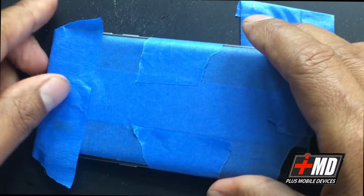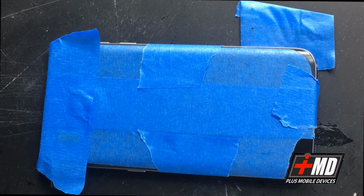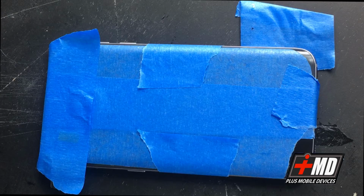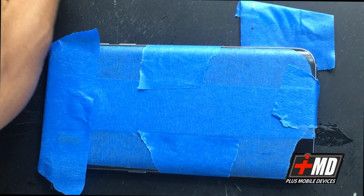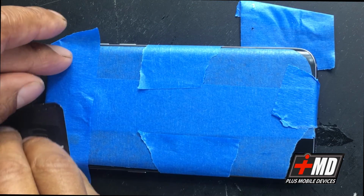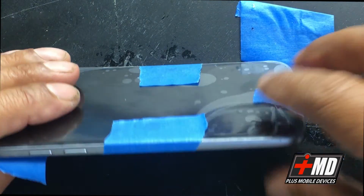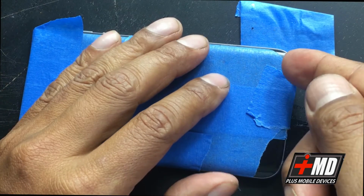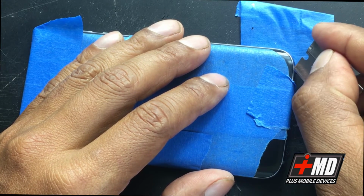And the thing about this adhesive is it's not heat activated. It cures by air and it's silicone. So should you have to repair this again, all you really need is a small razor to hit on the edge, and once you break the silicone seal, you just get a business card, and it should come off fairly easy once you break the initial seal. And you can cut the seal, and then you can rub it off again, and the same for the front. So the seal is really strong and it's watertight, but once you decide you want to replace it, all you have to do is lift it. You get to a point where you can do a nick and a cut.